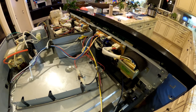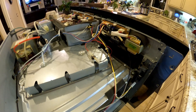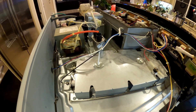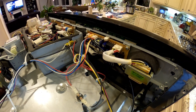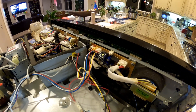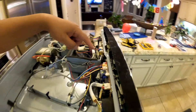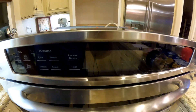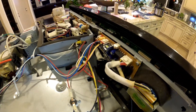The only thing I did is make sure it wasn't the microswitches, made sure it wasn't the thermostat, ruled out the capacitor, and then got a control board. If this doesn't work, I'll do the Digitron - that's the display, and it costs $260. But I'm very confident this is it because we've seen those burnt marks on the board.